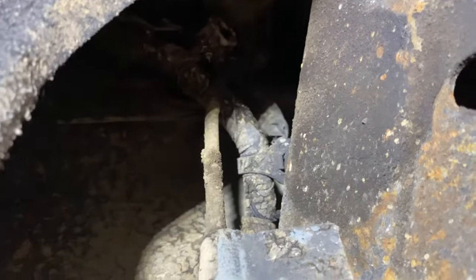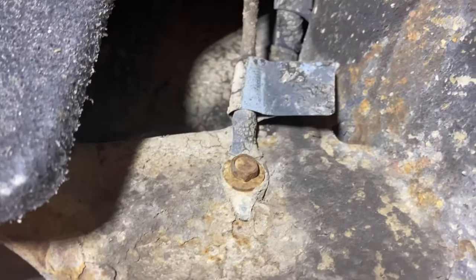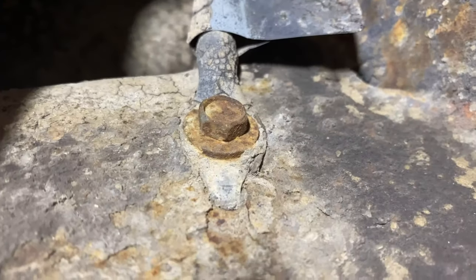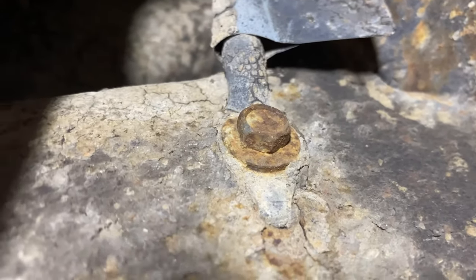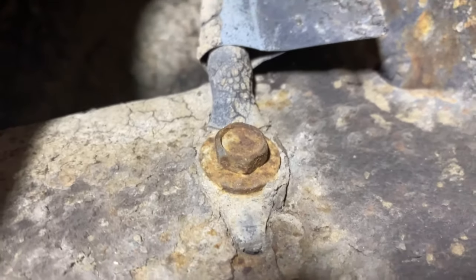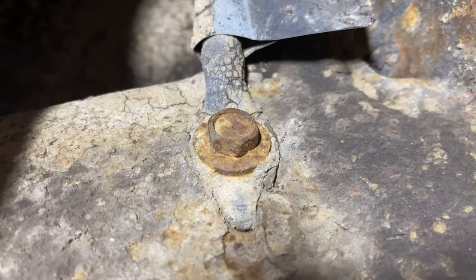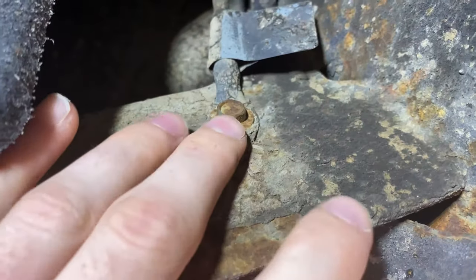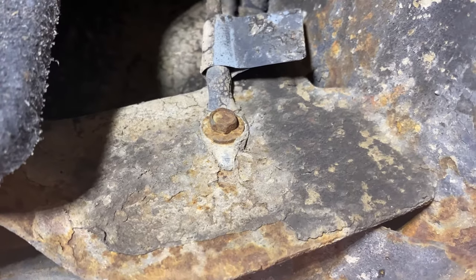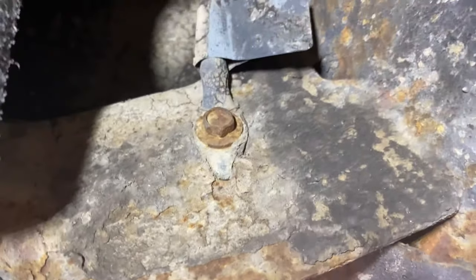Once you find your way underneath the truck, you'll see that bolt right there. This is like your secondary ground — it comes stock from the factory. But as you can tell, that doesn't look very well grounded; the condition of it doesn't have a good connection at all. So I'm going to go ahead and take that off. I disconnected the battery so it's safe. I'm going to clean this up as best I can, scrape off what I can, sand what I need to, and then place it back and spray some black spray paint over it to protect it from rust later.